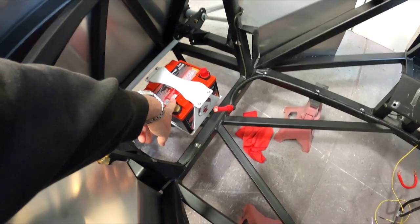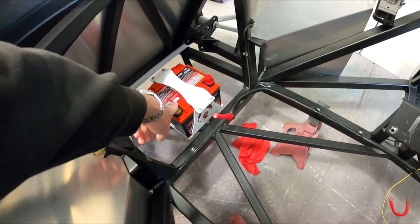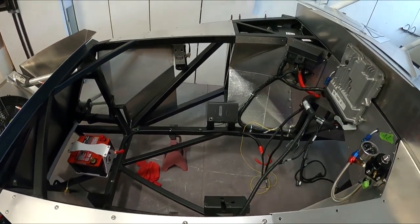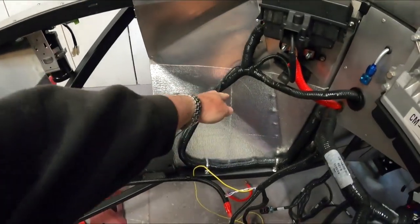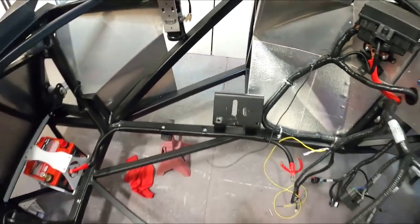I'll fab up the ground cable here. I ordered a new crimper for these — I've been soldering all of them and I'm going to start crimping them. This one is going to go from the ground to the chassis here, and then probably from the chassis I'll run it back and tie into the engine. That should give me two good points of ground: one to the engine, one to the chassis. Then I can tie everything else from there, and you've also got the ground wire for the Coyote which will tie into this ground that goes directly to the ground on the battery.